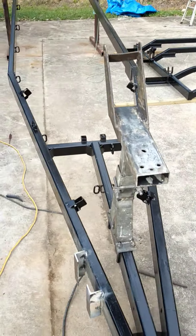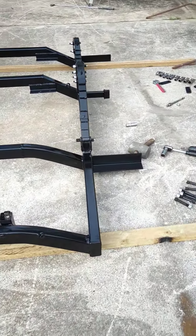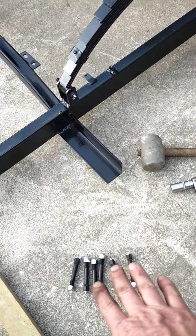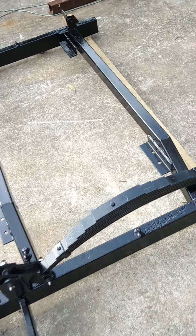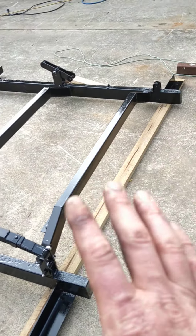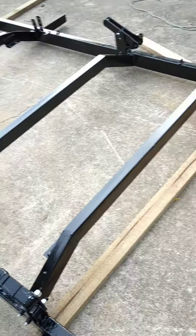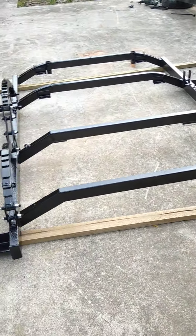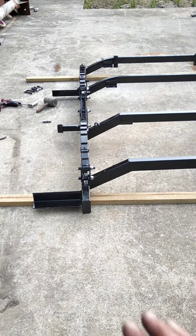That bracket support will get painted once I finish the bottom rolling chassis part. At the moment I'm putting all the new bolts in — springs, rockers — all going in nicely, everything being painted. One thing I've found with using penetrol in the kill rust black is it's made the paint quite soft and it scratches easily.